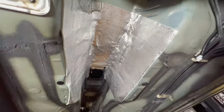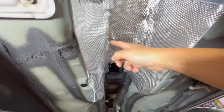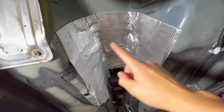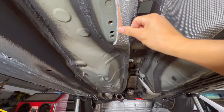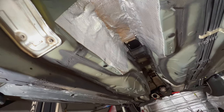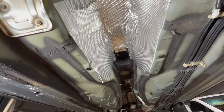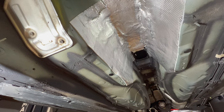We got everything in there. It took a little while to get everything to stick correctly, and I had to hammer and roll all the areas with the screws above. The adhesive didn't get very good contact there, so you have to hammer in all those little spots on both sides. I started on a straight side but due to the curve and stretch it ended up diagonal and kind of hangs over — hopefully once I tighten it down it'll be flat. On the edges I had to trim, there was some bare fiber, so I used tape to clean up those edges. I do recommend putting a mask on and safety glasses so you don't get these fibers in your face. This is fiberglass and my arms are itching right now because I didn't have long sleeves on.